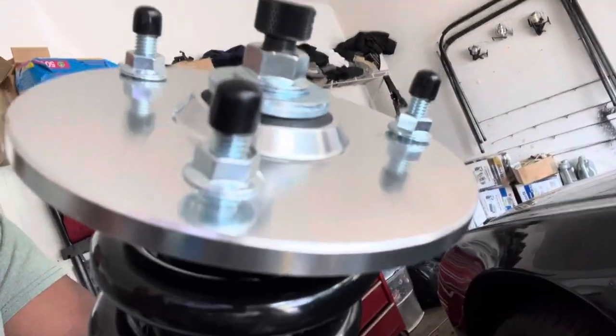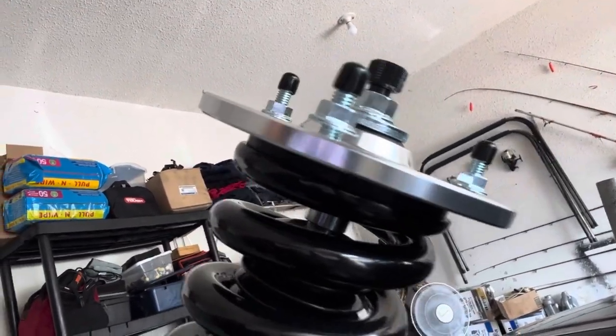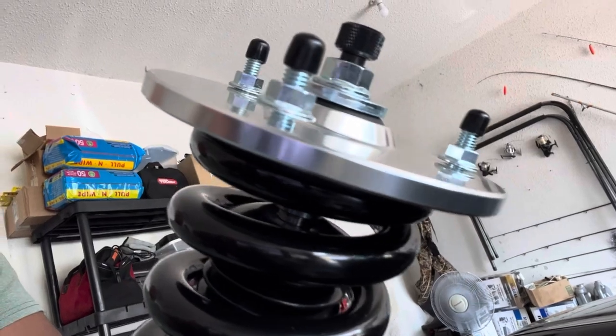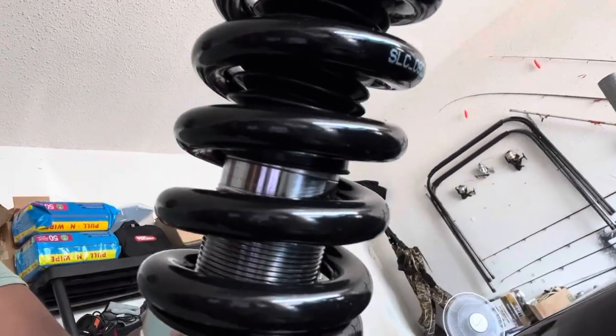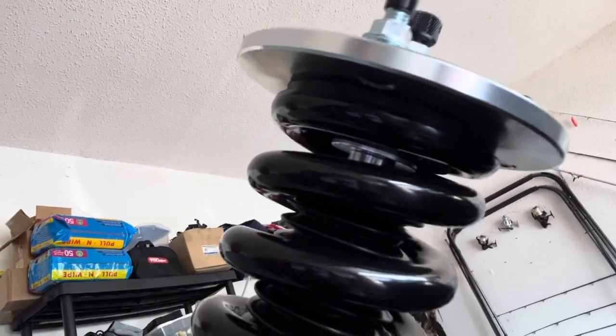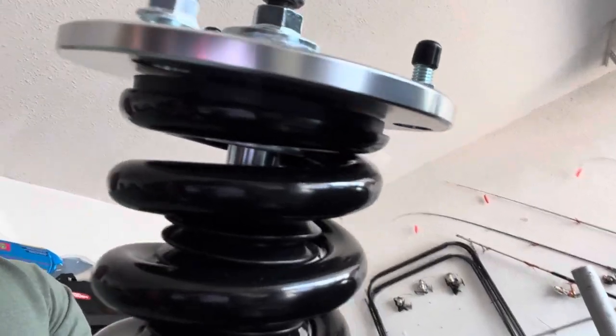There's a bearing in there. That bearing allows the top to adjust when you steer so that it doesn't create excessive tension on the coilover or on the spring. It is designed to spin slightly left and right, or clockwise and counterclockwise, when you turn. So if there's too much spring on here, the spring itself will bind and it will pop. You hear a loud pop or metallic popping noise. And that is the spring freeing itself or unloading, I guess, onto this collar or across the top.